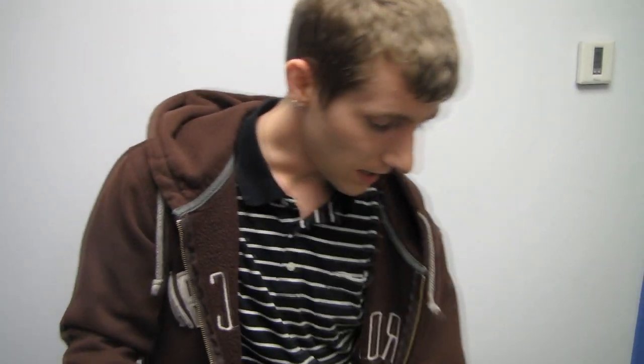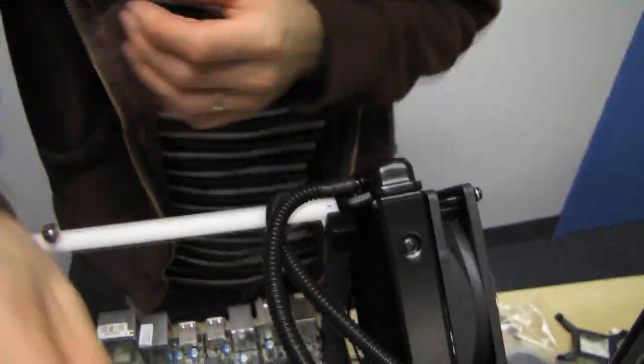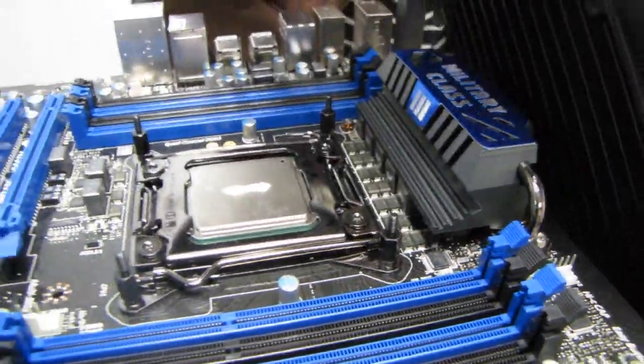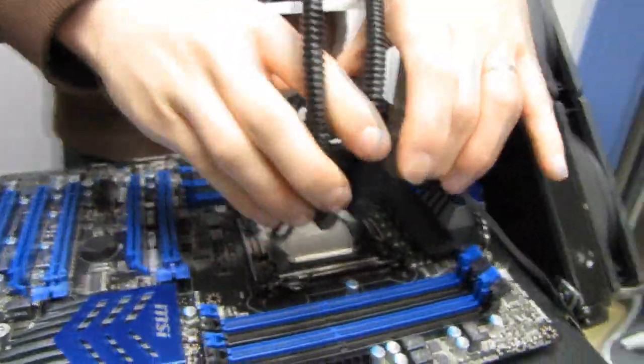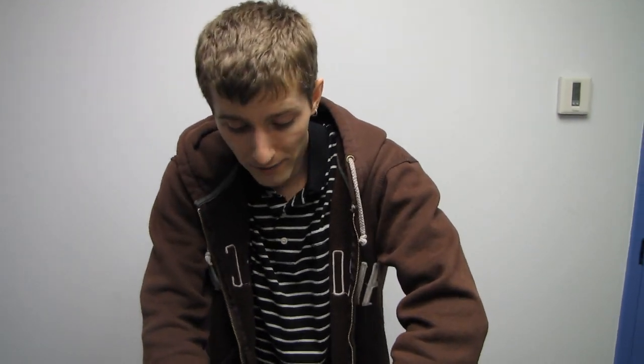We're going to have to re-film — we learned something. Instead of using the standard Intel procedure with the Intel pegs screwed into the backplate, even though the backplate has the appropriate holes for 2011 and the spacing is right, you don't actually use it. You use these ones instead and screw them directly into the built-in front plate on the motherboard. If you use those longer pegs, you're not actually going to have any contact between your H100 and the CPU at all — so don't make that mistake.